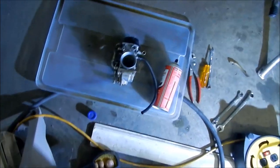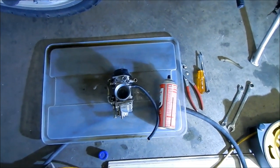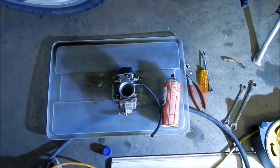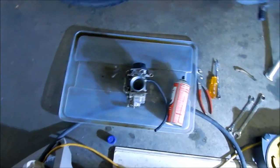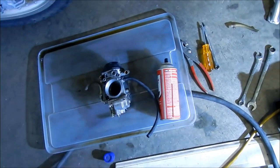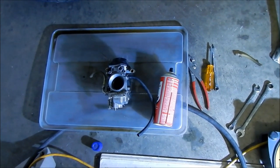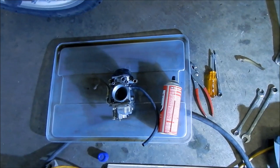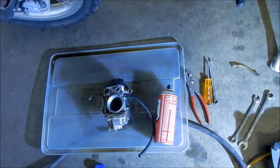I've got a couple of solutions for really cleaning up a carb. I've got this little chemical bucket I bought a while back just for cleaning carburetors — you're supposed to dip it in there and it soaks and cleans all the orifices. But to do that we need to remove all the little parts like the jets and plastic stuff first. If that doesn't work, what I found works really good is Pine-Sol and an ultrasonic cleaner, and I have that also.